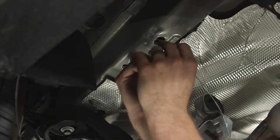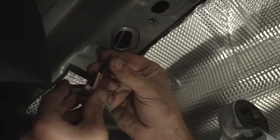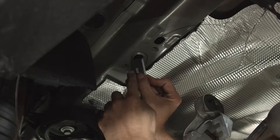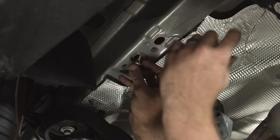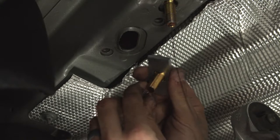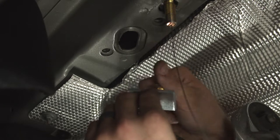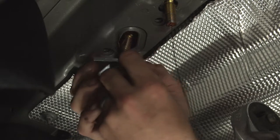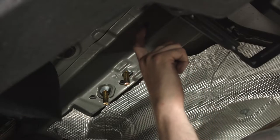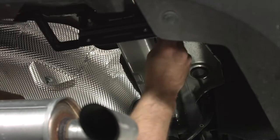Next, we're going to take the fish wire and come back through the attachment point through the access hole — feeding on both our spacer block and our bolt again. Then we'll take the provided fish wire and reverse fish wire up through this access hole, putting the block and bolt on the fish wire, keeping the bolt up through, and then the spacer block, and pull back through. We're going to leave these fish wires attached so we don't lose our bolts up in the frame when we go ahead and attach our hitch. Now we're going to do the same thing on the passenger side.